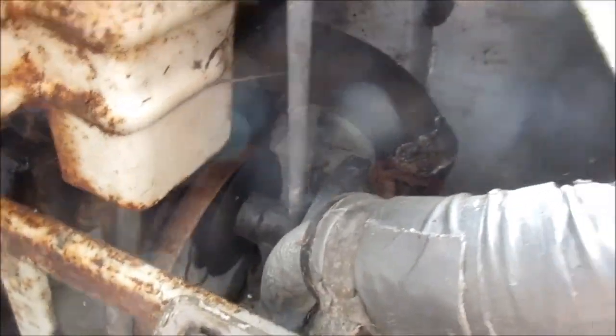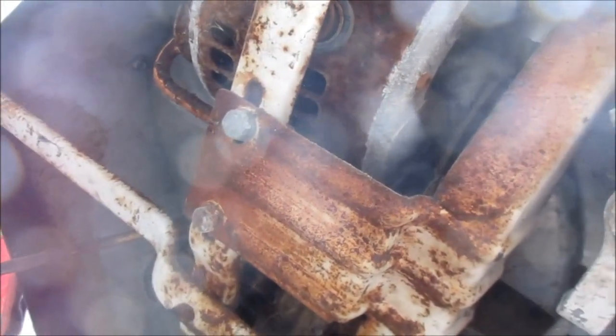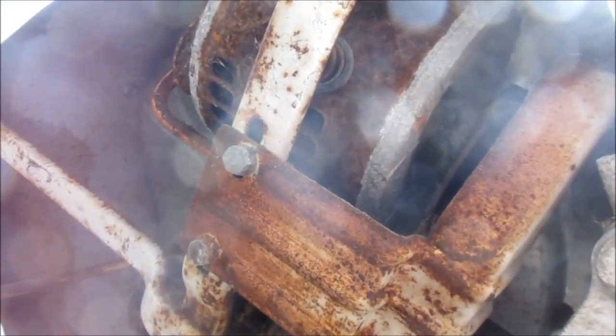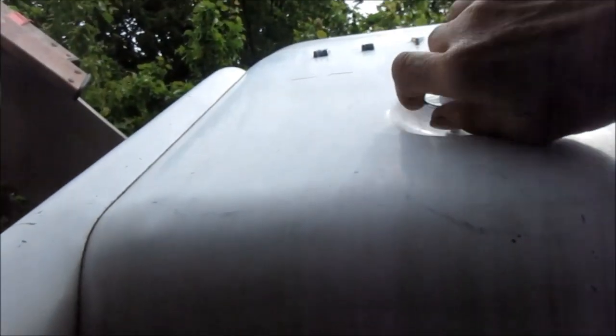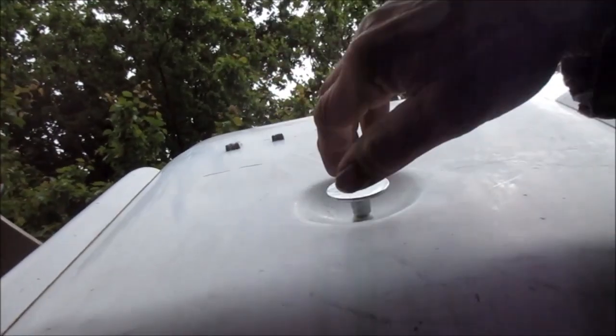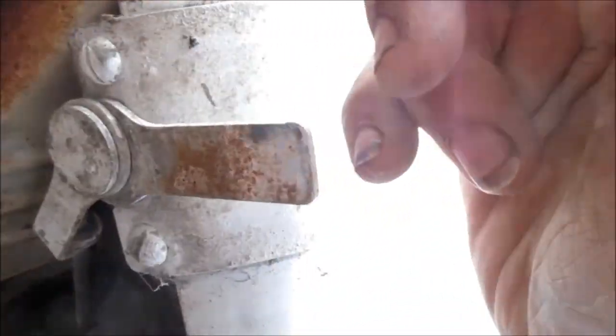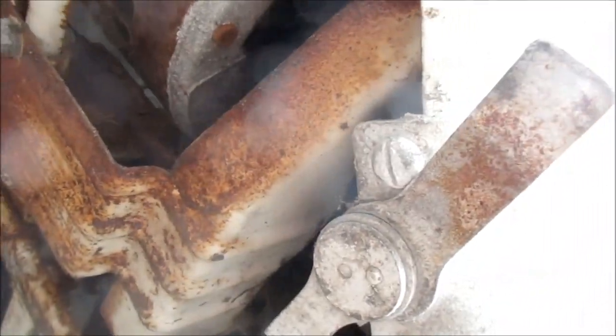At this point the pump is engaging — it's not frozen up or anything. The motor runs, it's not loud or anything. I believe this lever here in the front is actually the agitation. This is all manual, so you just pull it out for agitation, leave it on as long as you want. When you're done, push it in, leave it on, then pull the pump lever so the pump comes on, and then you can wring out your clothes.